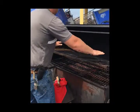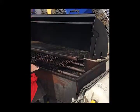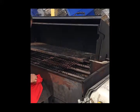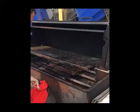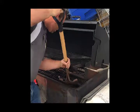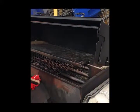Once you've gotten all this relatively clean, go ahead and reach in here very carefully. Slide that bottom cover off — just slide it over and make sure it's out of the way. And you can come in here with a shovel or a rag or a brush or a piece of paper towel. Just come in here, scrape that grease that might be on the bottom out and dispose of it appropriately.